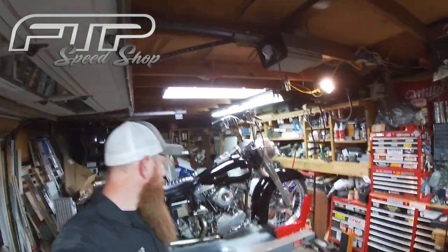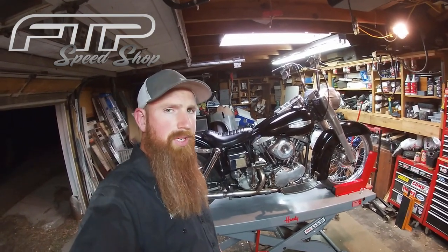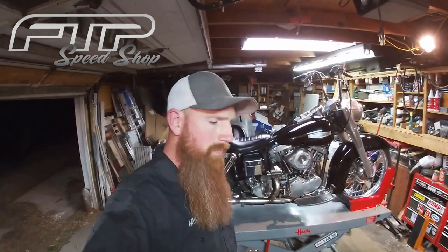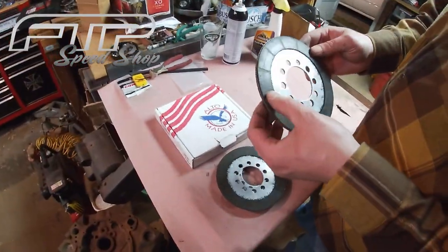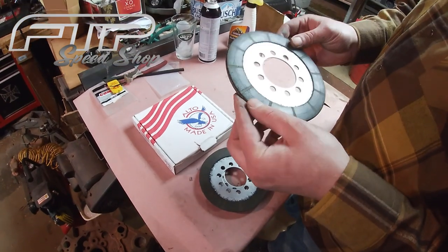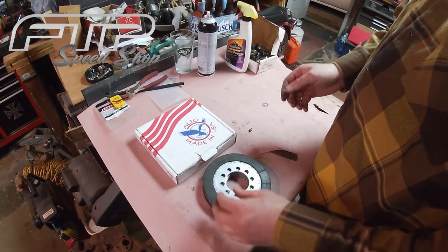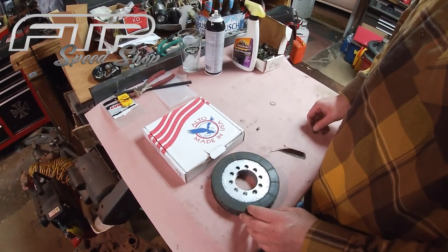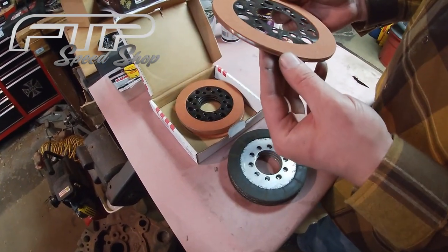We took a little road trip today over to the Nova Shack to work on Zack's 1968 Shovel Head Harley Davidson. We're going to help him replace the clutch. Here are the old fibers - he took them out last night and they're pretty well worn. Everything was all gummed up and the clutch was really grabby, so he went down to the local motorcycle shop on his lunch break and got a new set of clutch fibers.